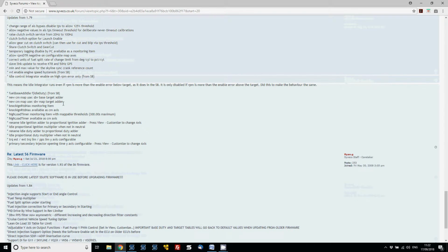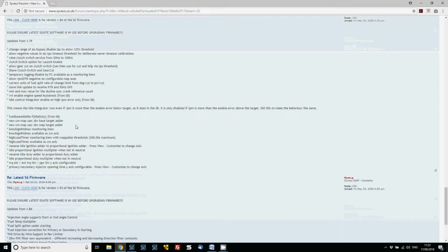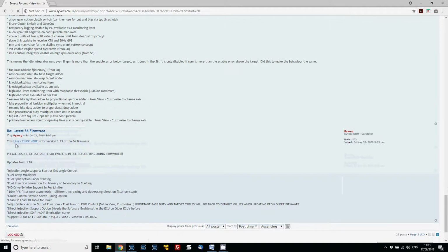Oh, we've got 1.84, but 1.85 is not on there. Okay, so what that means is we need to basically do two things again. We can either go back to the 1.57, or let's bring it up to the latest firmware version. So let's click on the link and download the latest firmware for the ECU.